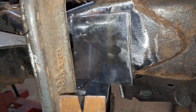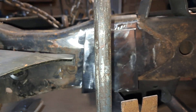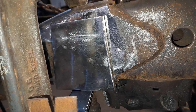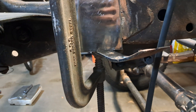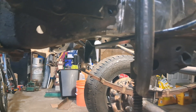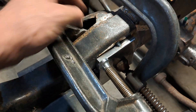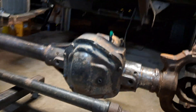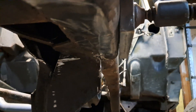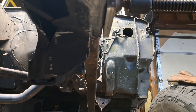So I got my half-inch plate cut here, cleaned up. I got the frame all cleaned up, and I'm just trying to get myself into a good position where the spring hanger is going to be on there good. I'm going to tack this on here and see how it looks. I think I have this positioned where I want it. I have a C-clamp with a pry bar flat against the bottom of the frame so that the plate is flat with the bottom of the frame also. I got the first half-inch block on here. I'm going to tack it in a couple more spots, and then I'm going to burn this thing in. From the bottom here, the frame has kind of a rolled edge there — I'm going to burn that all in, fill everything in, and flatten it out, and I'll have a good mounting spot for the spring hanger.